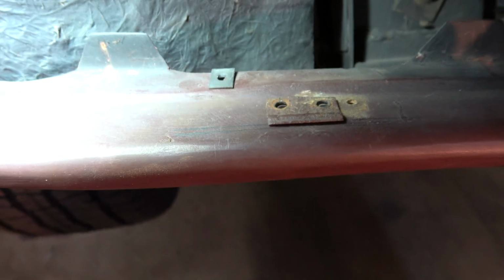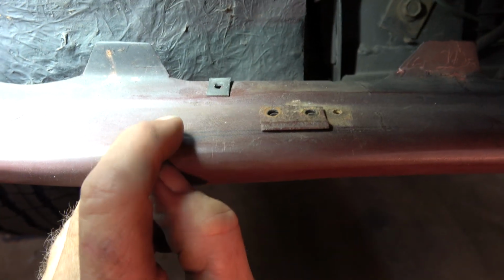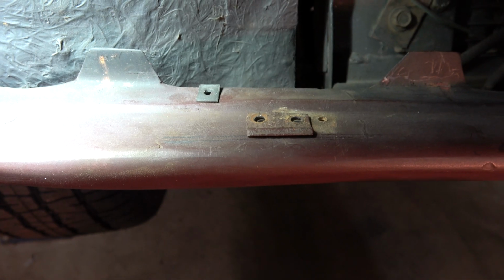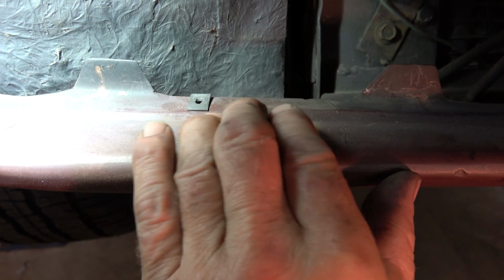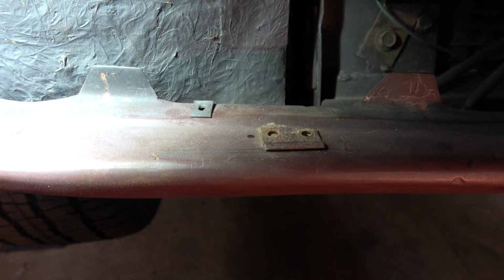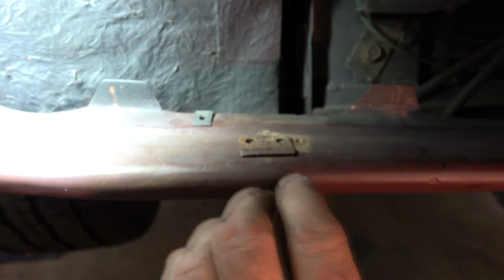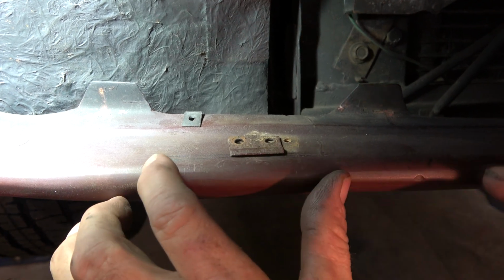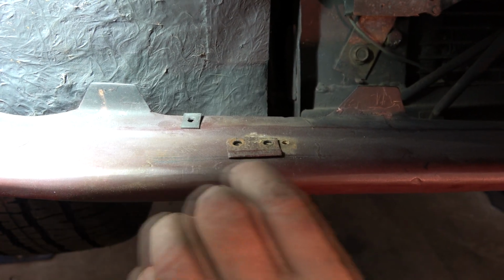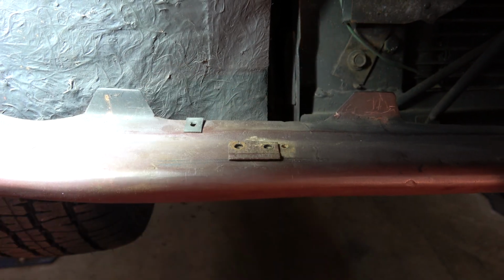So what we did is we put the piece on and then had the other screws all in holding the place. Then we drew lines, the little lip of the chrome, and we could see that this thing was no way gonna touch it when it was back here. So then we just moved it over a little, and he got it over the lines that we drew, because we took a straight edge and stretched those lines out. And now he's over that lip, and we'll drill 2 new holes.